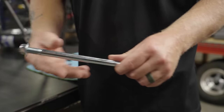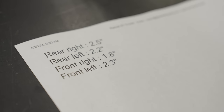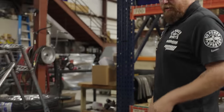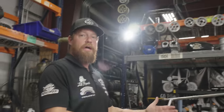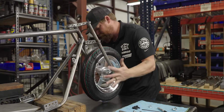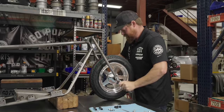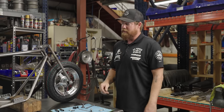In this kit you have four different wheel spacers. The front right spacer is for when you do the brake boss on the right side. Let's slap this wheel in there. Front right — that is from behind the bike like you're sitting on it, right side. It's 14mm on the head of the bolt and 17mm on the nut. Front is done — you can see how easy that was.